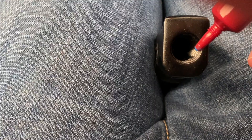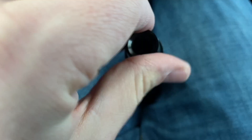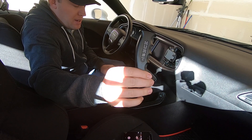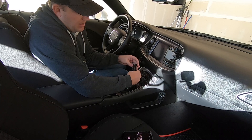I've got my blue Loctite here. We're just going to put this down into the threads and screw this guy back in. I think this is the easiest way to avoid dripping — if you put it on the threads and tried to screw it on, it would drip on you. So we have the adapter all on here. We're going to screw this back on. Just go down as far as the adapter will let you, and then you might have to bring the nut back up to where the adapter is.